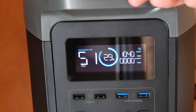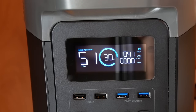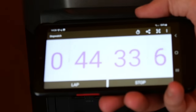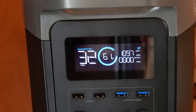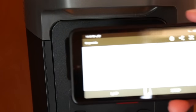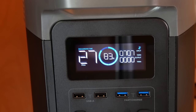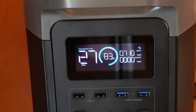We're up to 1000 watts going in at 7%. We are at 29% and just over 25 minutes in — 30% now, so at that rate we're looking at about an hour and a half. We're now at 60%, saying it's got about 33 minutes left, currently at 44 minutes elapsed — so about 77 minutes total, or an hour and 17 minutes. At 83% with around 27–28 minutes left, the watts going in has dropped to 700 from about 1100 peak. We are one hour and six minutes in, meaning we've slowed down with the input — so it's going to be a lot longer than an hour and 17 minutes.